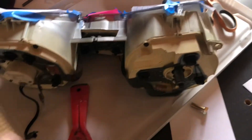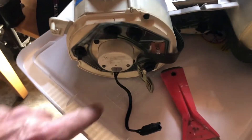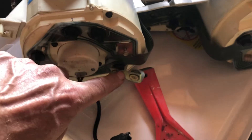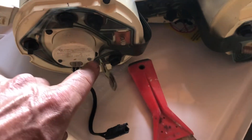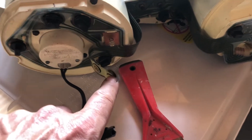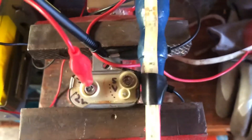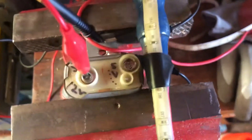In doing a bit of research, all of these instruments are fed by an instrument panel voltage regulator, or cluster voltage regulator, that plugs in right here. It's got 12 volts going in, and it averages out to about five or six volts coming out. It basically pulses the 12 volts on, off, on, off on a regular cycle — or so it's meant to. But when they're failing, if they're on all the time or pulsing erratically, you're going to see some strange things happening across those three gauges.